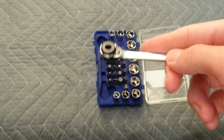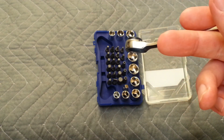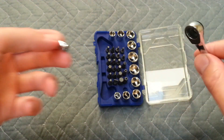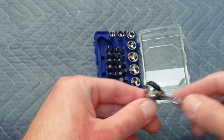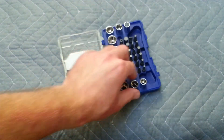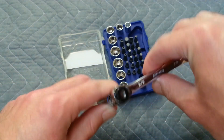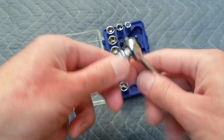I used this tool a couple times already. I used it to put in the Camry water pump — at the fasteners at the bottom of the water pump. It was kind of a tight area. To use the sockets, you have to use this adapter. You stick it into the 5/16 side, and on the Camry water pump I stuck the 10mm socket in. It was nice that it had fine teeth and it's relatively not bulky with the socket.